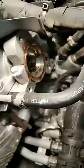Always make sure these O-rings don't get damaged — put them back on there nicely. You don't have to time it, you don't have to put any RTV — just loosen them up where there's enough play. We're gonna get that bracket loosened up and have enough play to get the rest out of there.